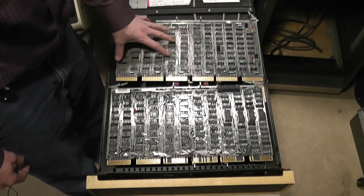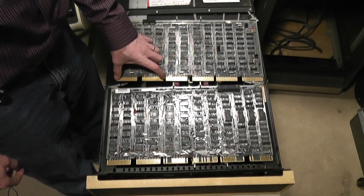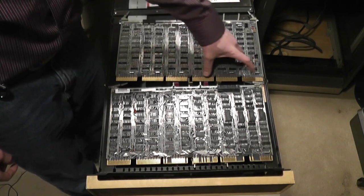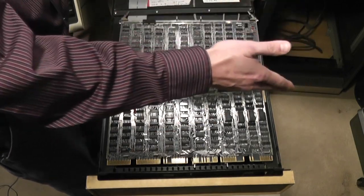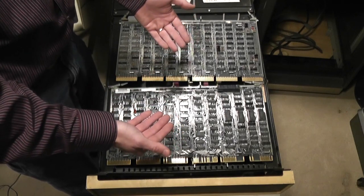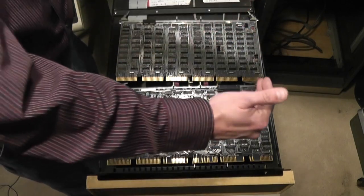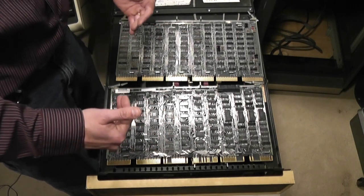All of the boards in this machine have these dual finger slot extensions on the bottom. They're in pairs, separated by a slightly wider gap. The CPU is dedicated to two slots on the very end in a portion of the motherboard that can only hold the CPU — you can't put anything else in those slots. The rest of the slots with some minor variations are effectively the same from one end to the other, so you could put most of your I/O devices, memory, etc., in almost any of the slots across the rest of the back plane.